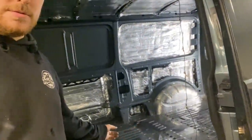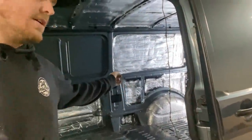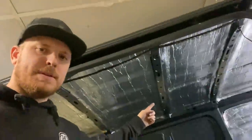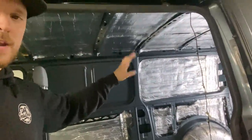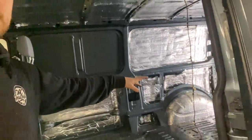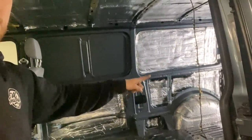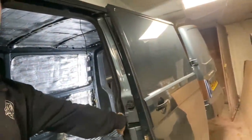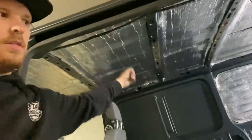Apparently I've not filmed anything for a few days other than the GoPro stuff of what I've actually been doing — I've just done no to-camera stuff. But we've made quite a lot of progress. We've got the sound deadening on both rear arches, the lower panels all the way around the van have been sound deadened, the roof has been sound deadened, and that panel up there has been sound deadened as well. We've now also put the first layer — the sticky self-adhesive insulation — in that panel, that panel, that panel, this one lower, and in the sliding door as well. And we've also done the roof.